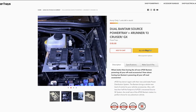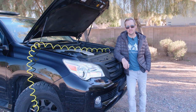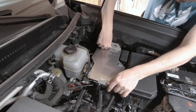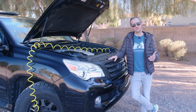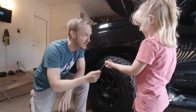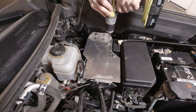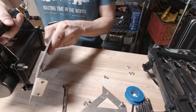Most of their trays are designed to have the hardware undermounted to give more clearance so you can use both the top and bottom of the tray as a mounting surface. Since the Smittybilt is a bit taller than the ARBs normally mounted to these trays, Maverick suggested we try a new tray he had developed for the 460 with the hardware on top, more like some of the typical mounting solutions on the market. The tray mounts to the upper inner fender and the support leg mounts to the lower inner fender. It's a bit tricky to get the lower leg mounted because you've got to get your hands behind the tire and the shock mount to get the nuts on — you might want to find somebody with small hands to help. You're going to find two 3/8 inch studs, and be careful, there's a lot of sharp edges back there. Next, I marked and drilled the mounting holes. The hole for the bolt under the piston was obscured, so I had to kind of triangulate using a T-square to drill that last one. Finally, I uninstalled the tray, remounted the compressor, and reinstalled the whole thing.